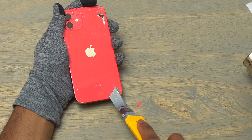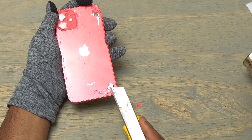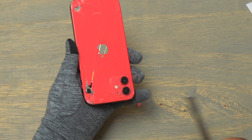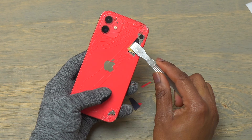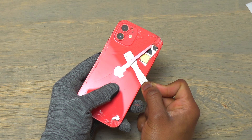You're going to use a heat gun in order to heat the back of the device. This is the first step. You need a heat gun because a hair dryer is not going to heat enough of the back to allow this type of back glass replacement. The motion is to heat the back of the device for less than five seconds on the highest setting, and after that you take your tool and remove the glass.